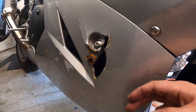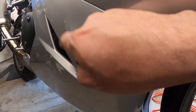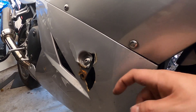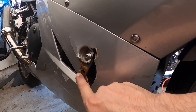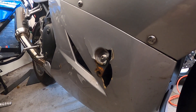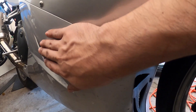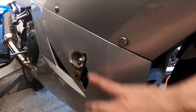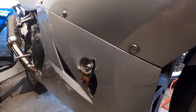All I need to do is cut out this little square piece here, get another piece of plastic off of another stock fairing, plastic weld it back in, cover it in plastic epoxy, sand it down, and then just get this one thing repainted — or even repaint it yourself. Painting plastics isn't ridiculously hard, and for the cost you're saving it's definitely worth it. You're not going to find anything to match perfectly anyway.